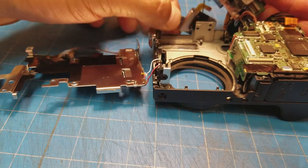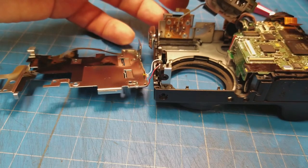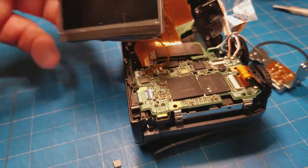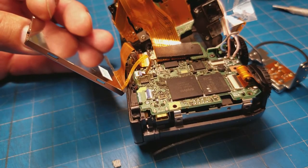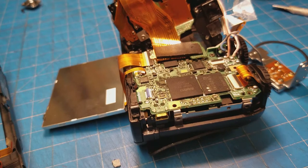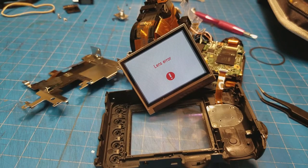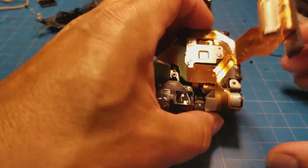I'll just flip that over and be careful about the wires left over. We've got the lens assembly, the flash up here, and the viewfinder — the viewfinder will probably get mounted first when it goes back together. Now at least we have our lens assembly free and we can start looking at what's causing that chooch issue. I think I've got all the cables connected — the display cables, the thumb wheel. I'll leave disconnected the hot shoe and the buttons and speaker on the side, so no sound, but hopefully we can get some chooching on that lens. Still gives the lens error.